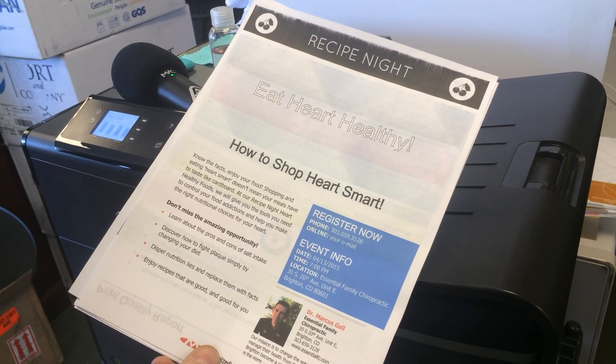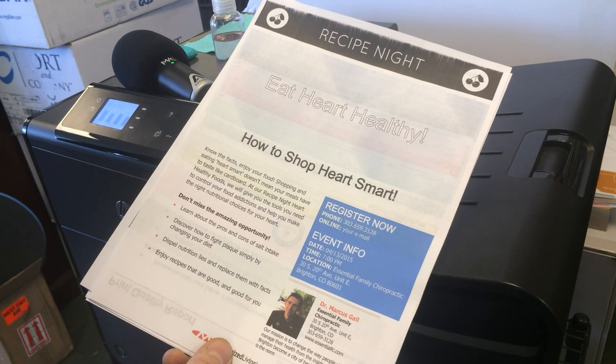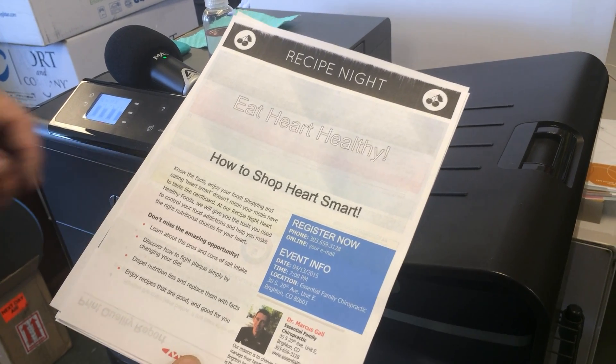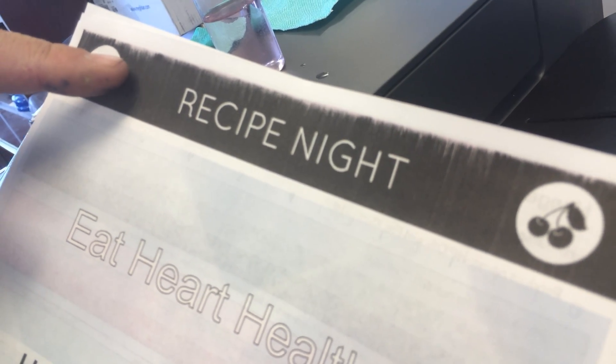There are about 42,000 nozzles on the printhead. When it's fired onto paper that's not very absorbent, some of that ink actually gets misted back into the printer, lands on the printhead, gets wiped into the waste ink tray, builds up to the point where it can get wiped back on the printhead and cause nozzle clogs.